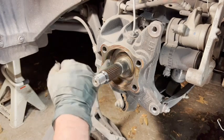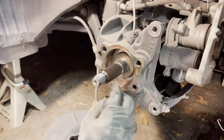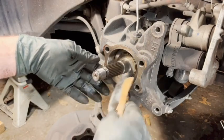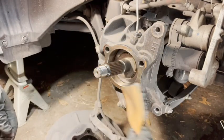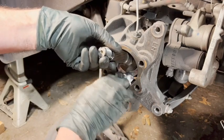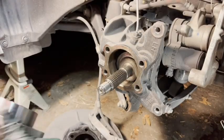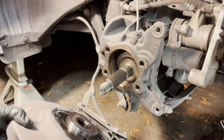In my case this looks a bit dirty in here. I'm going to brush it out and put a thin layer of bearing grease on here just to help it slide on — not much, just enough. There's just a little surface erosion; looks like this got serious water exposure at some point. I live in Houston and we get a lot of rain, so that's probably it. Got it cleaned with a very thin layer of grease, most of which I wiped off.